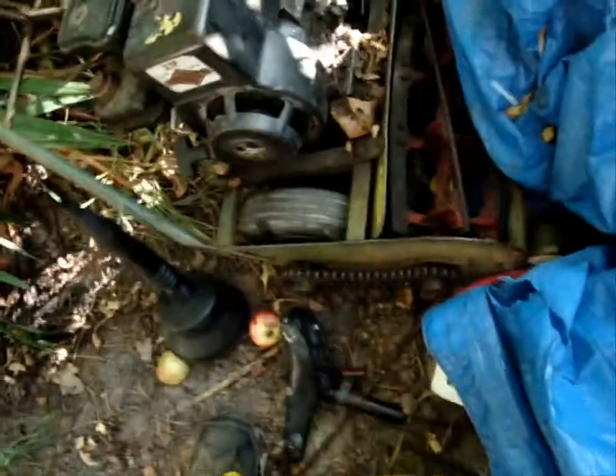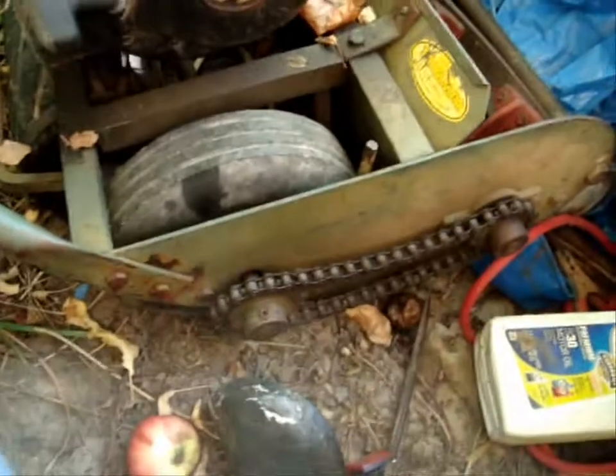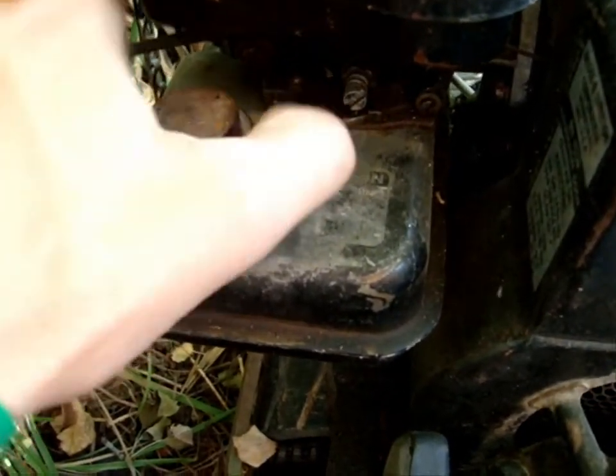Here's something YouTube hasn't seen in a long time - my two horsepower four-cycle Briggs & Stratton, Milwaukee, Wisconsin, USA, gasoline, made in USA. I've had this thing for a very long time - it's a real lawnmower and it just runs great. I replaced the gasket between the carb and the gas tank with leather. The gas tank is clean as you can see.